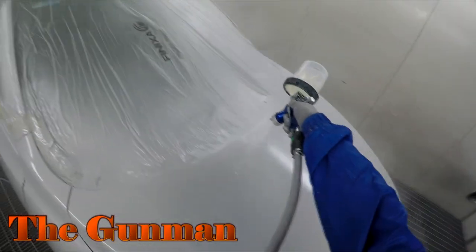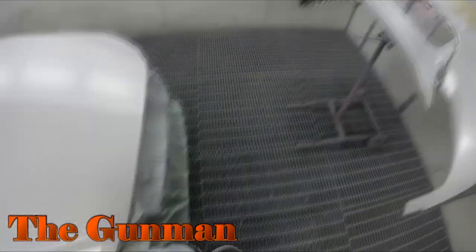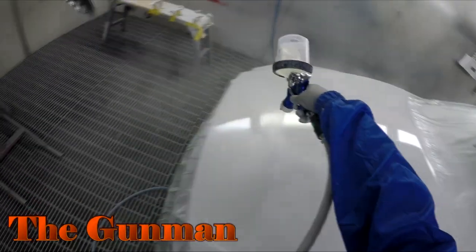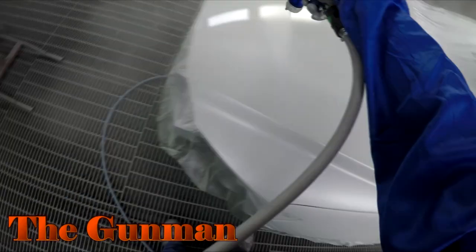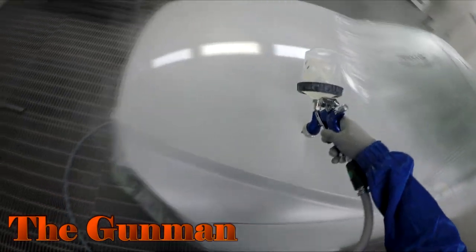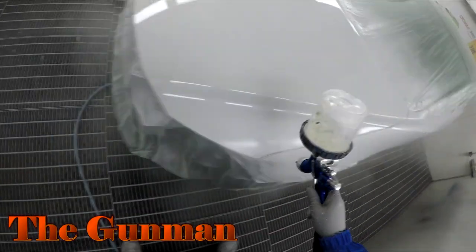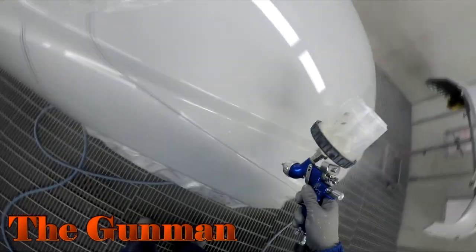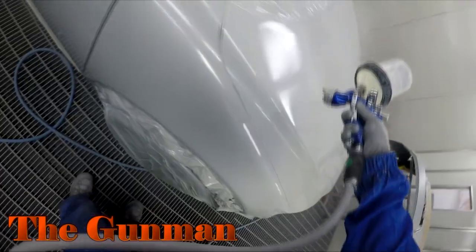For this entire job I mixed up 1.25 litres, and at the end of the job I had 100 mils of clear left. I was kicking myself — that's too much waste. I've seen people paint one or two panels and be left with more than that, but that's why I always try to push myself to get the best efficiency possible out of my clear coats and base coats as well. I don't want to be throwing out any paint, especially once it's got hardener in it and you haven't got another job ready to go. The paint's going to go hard and go to waste, so especially with these expensive clears, it's pretty important to be quite efficient when you're spraying and when you're mixing.